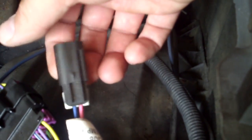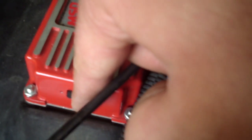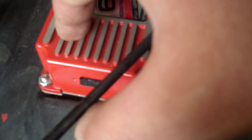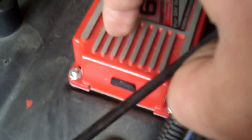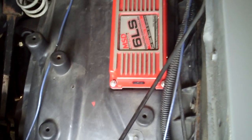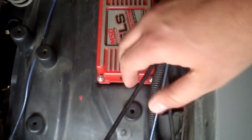There's another output — two wires come out of here for a two-stage rev limiter you can set up, which is cool for drag racing. There's also a DB9 serial port — make sure you use a laptop. The best thing to do is use an older laptop like Windows 2000 or XP. I know it sounds archaic, but the box is kind of old tech in a way — it's a little bit outdated. I have a brand-new laptop and I could not get it to work using a USB to DB9 cable no matter what I did. Just grab an old laptop with a serial port. The programming is super simple — I set my own curve and bumped the rev limiter to 6200 RPM. It's game on.